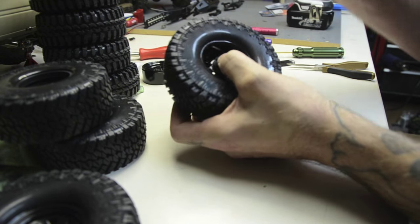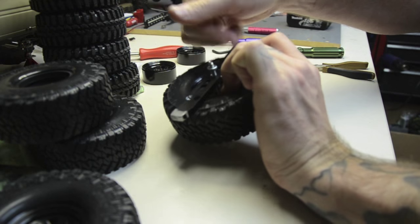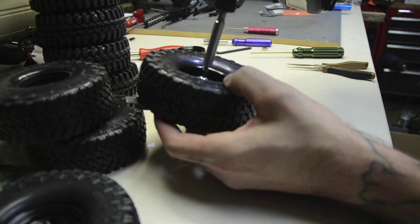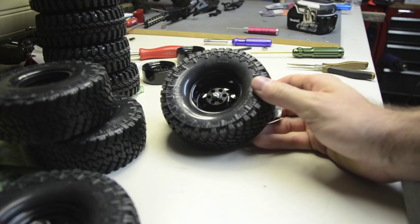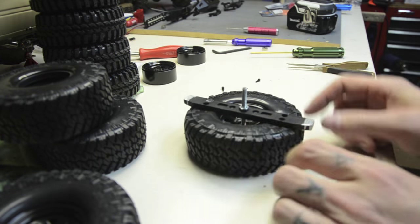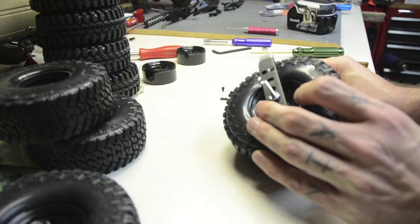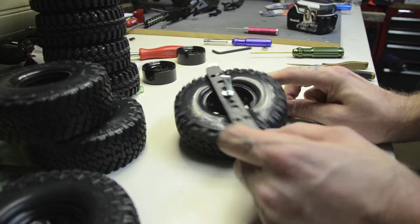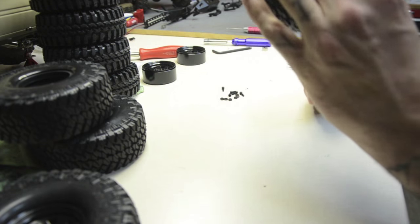Come back with the hub and line up the bolts, then drop the bumper jig on the front, grab the nut, and tighten it down as tight as I can by hand. Grab the Makita and just hold it on the other side — don't go all the way tight, but you can see it's really pulled the wheel and tire together and the holes look lined up pretty well. You can usually only get to one bolt on either side of the bar. I just use that bumper — it was on the frame for the Amigo build, an N2G knockoff D90 chassis that had been cut down, and I just came across this idea one day when I was having hell with beadlocks.